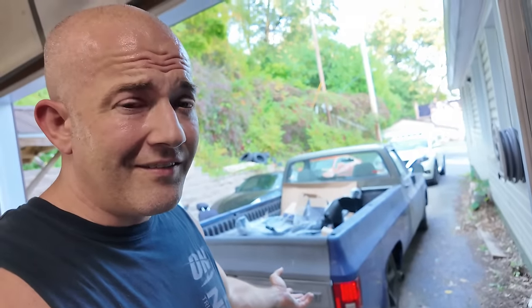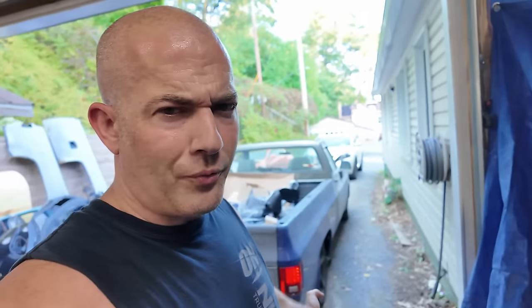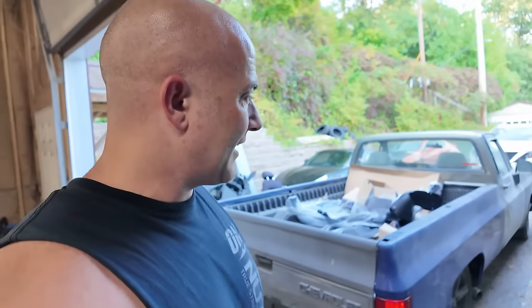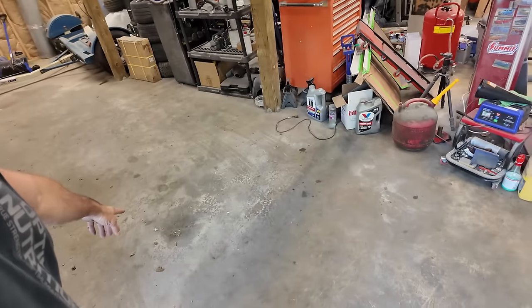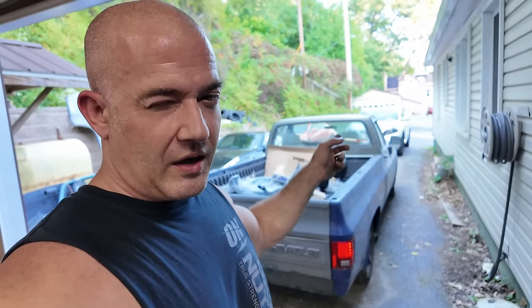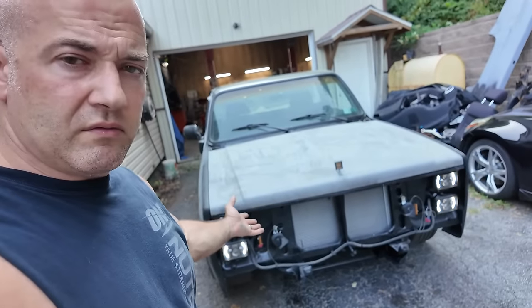It runs good. That's a plus. And the fact that it fired up. Now, it had an antifreeze leak. That was a simple tighten the clamp up. That's good. I like those kind of fixes. So I already fixed that off camera. But yeah, I was a little worried when I got out there. I just ran it the other day and I was like, I don't remember that. Then I looked under the hood and it kind of looks like it's leaking. It was the hose clamp from the overflow that goes to the overflow tank, right at the radiator. It was loose and it was leaking there. So we fixed that already. But yeah, she runs good. Fans are running. Let's check temperature.